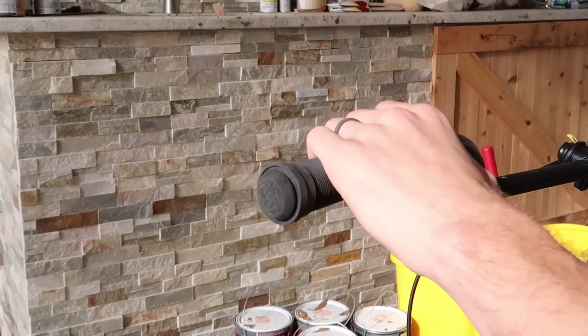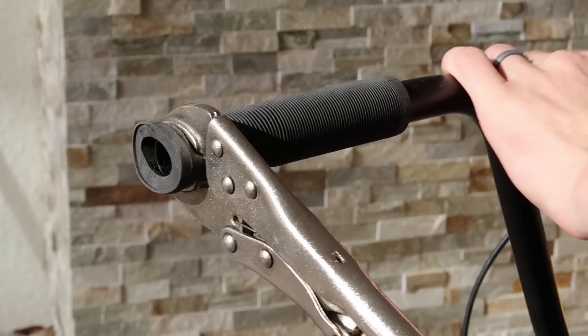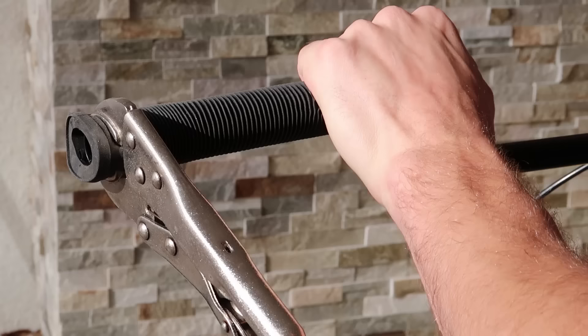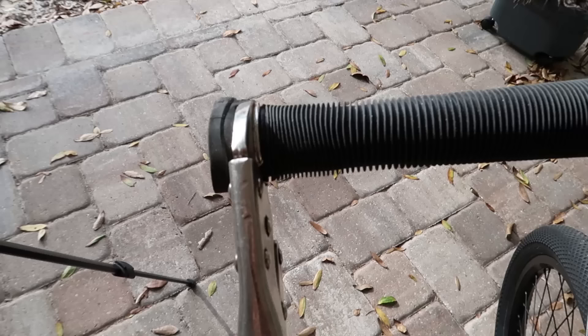So I'm going to show you my way to stretch grips out and make them feel softer. It doesn't really matter whether you use the compressor method or WD-40. The first step is to get a little bit of hangover on the end of the grip. Once you have just a hair of hangover, use some channel locks and lock them on the grips to keep them from moving. Then use your WD-40 or compressor and stretch the grips out. If you're using a compressor, be careful because you might explode the grip, so it might be handy to poke a tiny hole so it doesn't compress air in there. Look at how wide we just stretched this grip — a stretched grip feels way softer because the rubber is all spread out and you have a wider area to grab onto. When you take the vice grip off, it will naturally retract a little, and that's why we left that hangover there. As long as the underside of your grips and your bars are clean, you should never need any glue or adhesive. Do note that stretched grips may be more susceptible to throttle grip, so remember to keep them clean.